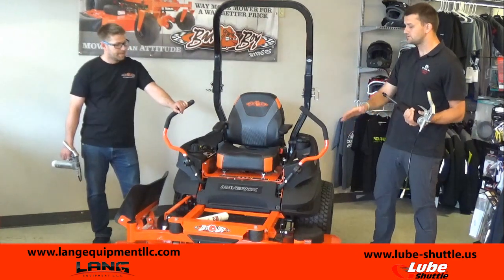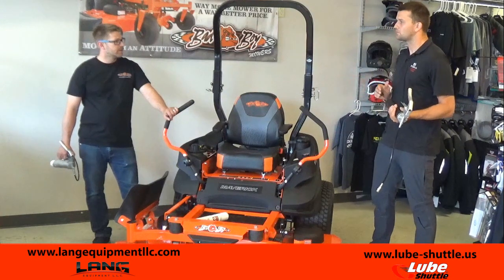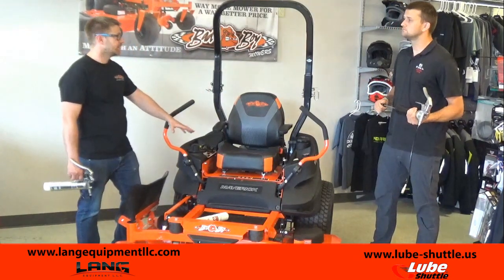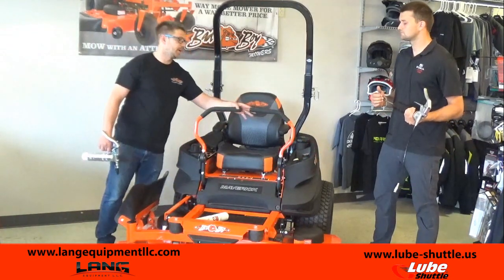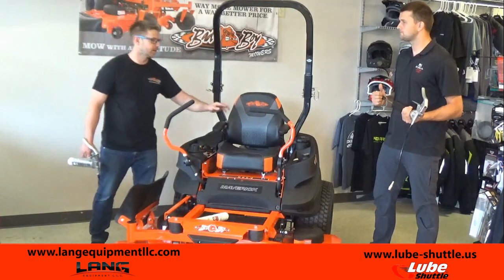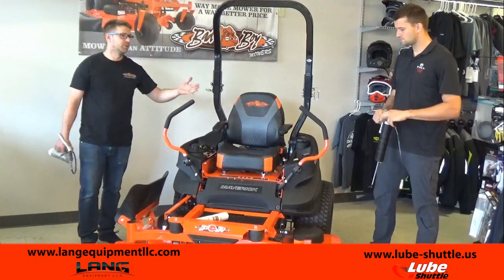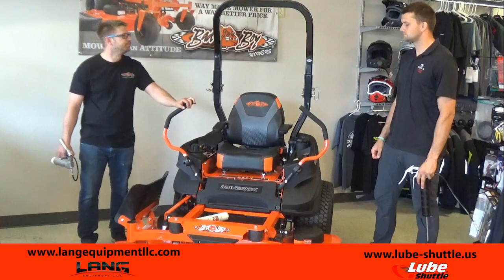And when you're greasing, you should just be doing a general check too on your mower, right? Making sure there's nothing that seems out of the ordinary. Yeah, making sure that your belt is free of debris is going to be a big one. Making sure that your handles line up when they're in here so that as you push forward, you're going in a straight line. Making sure that your deck is level is another thing. Usually that won't go off unless you run into something.